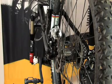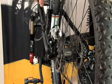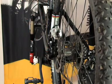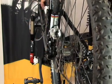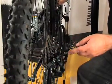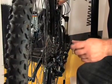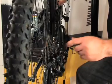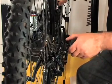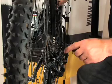Last but not least, we advise you to pay special attention to your quick-release. In combination with disc brakes, we recommend mounting the quick-release lever on the right side of your bike, as most quick-releases use a plastic washer that tends to soften under the influence of heat generated by the brake. Mounting the quick-release opposite to the standard position keeps these washers cool and thus prevents heat from reducing the tension on your hub.